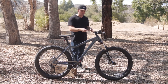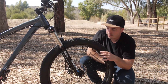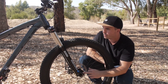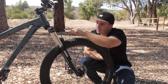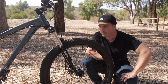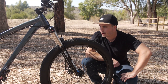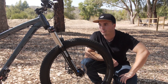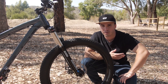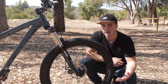So jumping into the front end: the Mason 1 runs a Suntour XCR fork up front. It's got a 15mm through axle and it's a boost hub. It's got lockout, preload adjustment, and 34mm stanchions. It's not the air version — it's the coil version. Obviously not the best fork out there, but for this price point it's really not that bad. We're going to run it as is, put it through its paces, and eventually if my cousin thinks he'd benefit from a nicer air fork, we'll probably upgrade. What's nice is this bike has a tapered head, which will make it much easier to go to a modern air fork in the future.